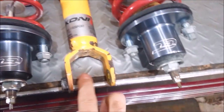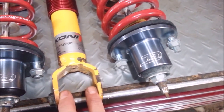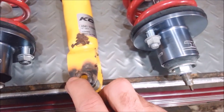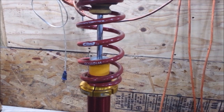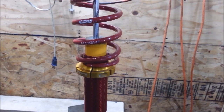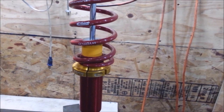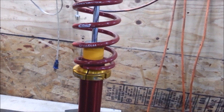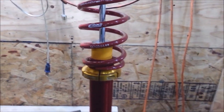The only difference is the Integra mount is going to be a little wider, so I've got to put some shims in to make up for the distance so I don't crush the forks. They probably used a torch to get this bolt out — they break a lot, so be careful. It's good to make sure the springs aren't over 400 pounds. Some people run 400–450 pound springs and you're really hammering the crap out of the shocks and can wear them out pretty quick. These are actually really light coils for Ground Controls.